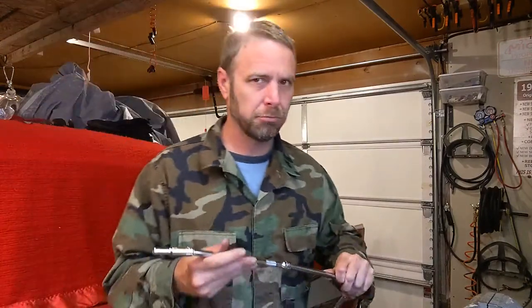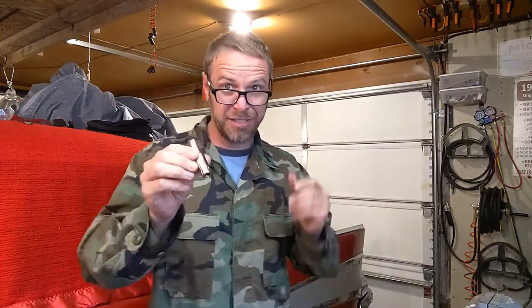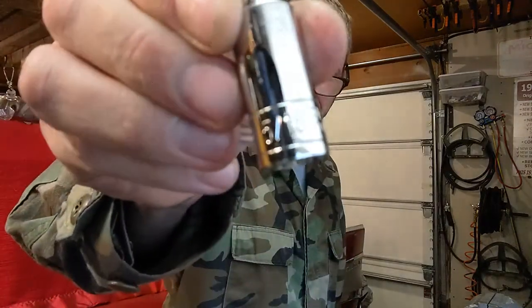So there's two things that make this job difficult. Number one is you need to make sure you have the right kind of tool. You need to have a really long set of extensions - that's not the hard part. The hard part is you have to have the right socket. The nuts on the u-joints that hold the straps are actually teeny tiny. You need this - it's a 5/16 socket.